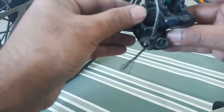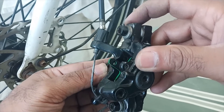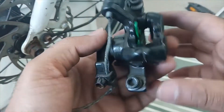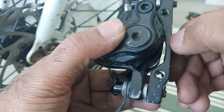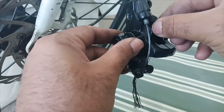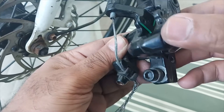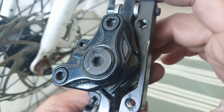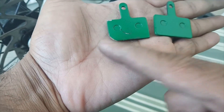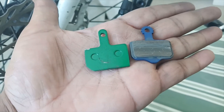The pin has to go from one side and it's not aligned. The brake pad gets stuck because the hanger is blocking it. If we can trim that area we can insert the brake pad. I've already done this on another brake pad — I trimmed the edge and inserted it and it perfectly fits. All you need is a little shaping and cutting the edge here, and you can use this standard brake pad instead of the unique one. Let's do the installation.